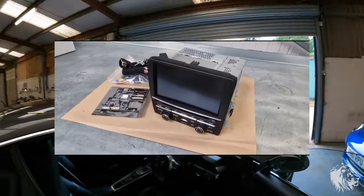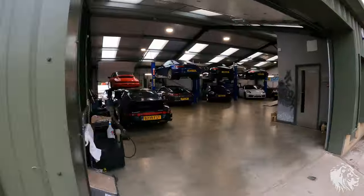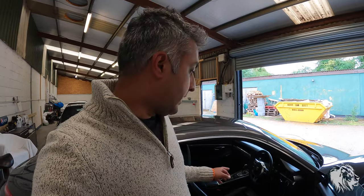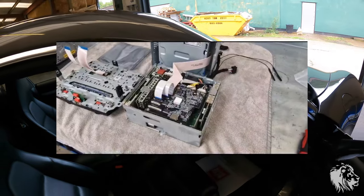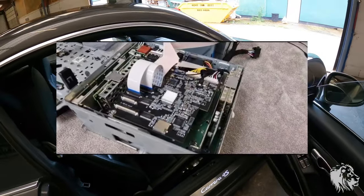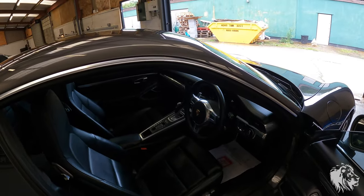There are now a few third-party motherboards available which can be installed directly into the PCM units by a professional. There are some people that try it themselves but I'd recommend getting a dealer to do it. We've used a fabulous company called Renworks Porsche Care. They took the car in yesterday and did it alongside another 981 GT4 side by side — the same install on both, because they both have the same PCM, even though they have different stereo systems. This one has the top-of-the-range Burmester; I think the other had Bose or Sound Package Plus, but that shouldn't matter for the CarPlay installation.